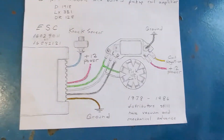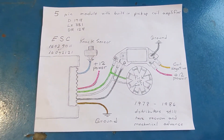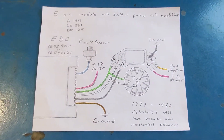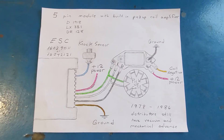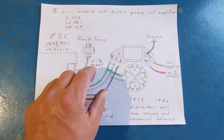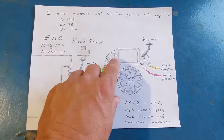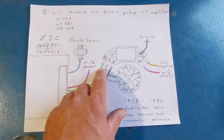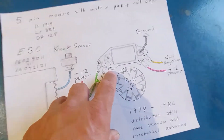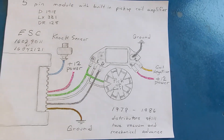Those ESC modules do go bad sometimes — they're going on 40-plus years. What some people like to do is a bypass when they can't find the module or simply don't want to use it. They want to eliminate it and just run the distributor completely internally without any external timing module. That's a pretty easy thing to do. You take off the timing control module completely, and outside of your distributor you'll have a connector with four wires. All you need to do is connect the green wire and the black wire — short them together. The pickup coil is going to send a signal through the green and white wire; the white wire is already connected to the module, and the green wire you loop to the black wire, which goes to the input D pin. Then this module is going to run exactly like a four-pin module — that's a pretty easy way to bypass the ESC module.